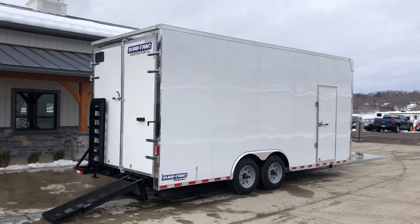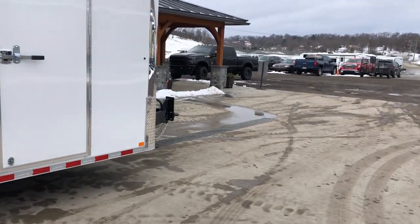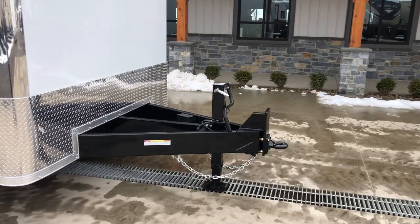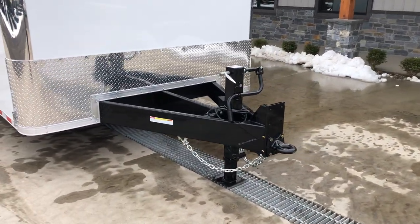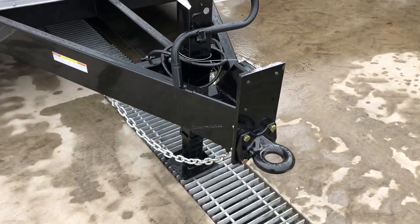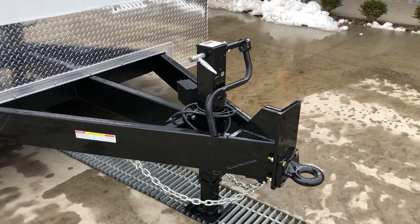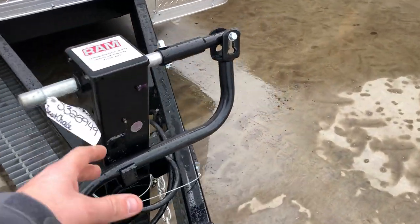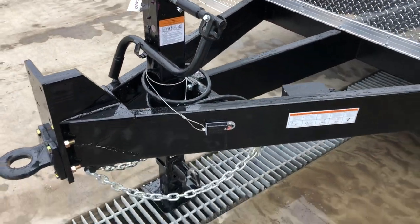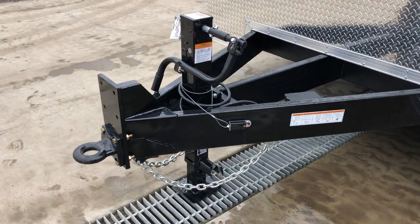Let's take a walk up front and get started at the front side of the trailer. Other than the 8K axles and the heavy-duty ramp package, most everything else on this is going to be standard. Up front, we've got the heavy-duty bullnose coupler. It has a pintle, and we also have optional ball mounts as well. There's a 12K jack, and on the heavier 12K jacks you've got grease zerks for serviceability. Just like your bigger, heavier-duty trailer, it's got a pull pin, spring-loaded, and it'll retract the pin.